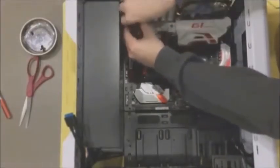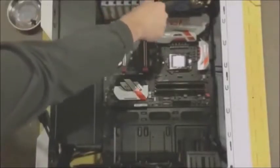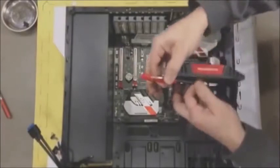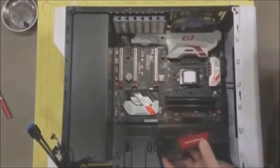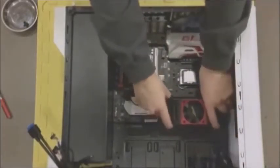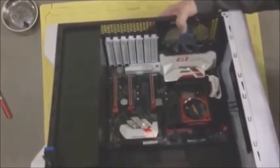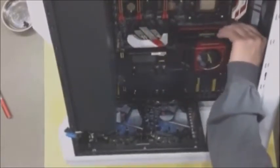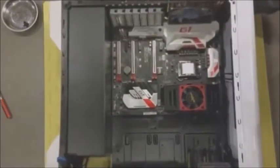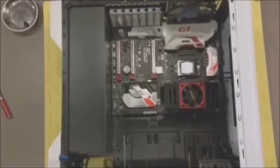This motherboard was very simple to install. The IO shield wasn't pushing against it like most motherboards, and I was able to get the wire through that plastic piece to get the IO shield plugged in. This is where I pigtail the active cooling RAM wires — since I pigtail them, I don't have to use zip ties, which makes it a lot easier to get the wires looking clean, kind of like a phone cord. The feet are rubber-foamed around the end so they slide right over the fan or RAM mounts. Because of the Corsair fan's direction, I pointed the CPU cooler straight up toward the two exhaust fans at the top of the tower.